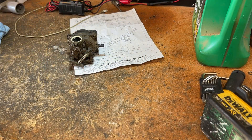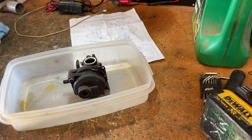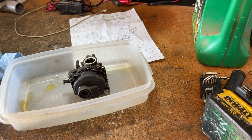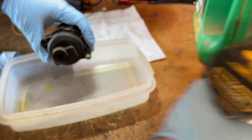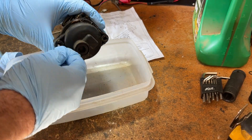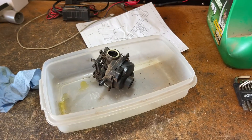If somebody's been into this carburetor before — I'll show you how I know this. We have the O-ring that's sticking out. For whatever reason somebody decided to open it up. It's not likely that was done from the factory. Hopefully that O-ring is okay — I might have another one. We'll see how bad this one is. 9/32nd socket. Those threads are still good — they've been into this before. There's a chance they damaged the threads going back in. People seem to forget that these are plastic carburetors.